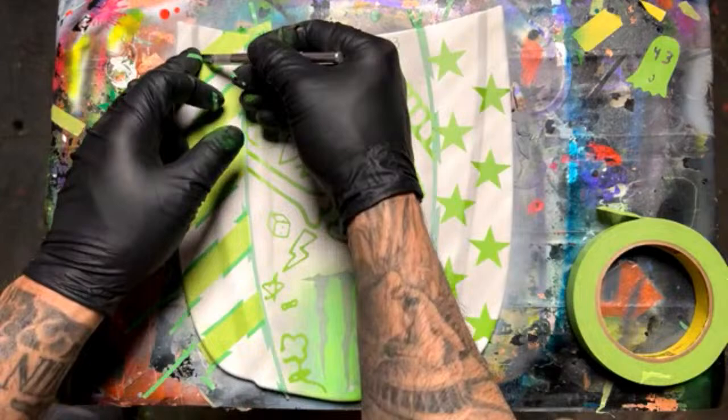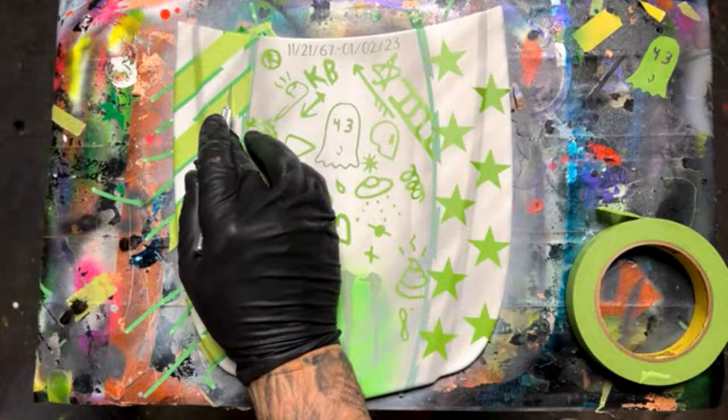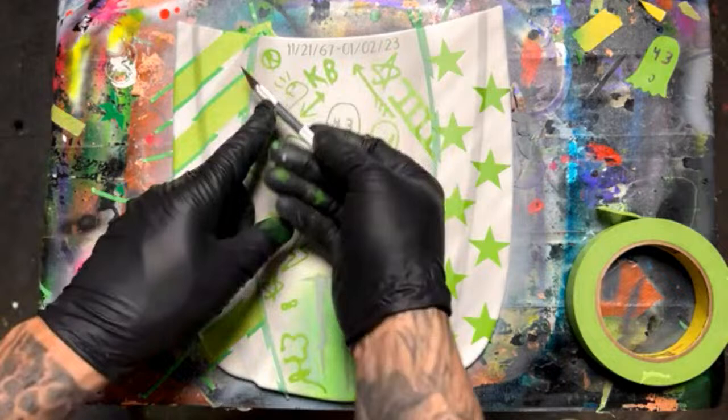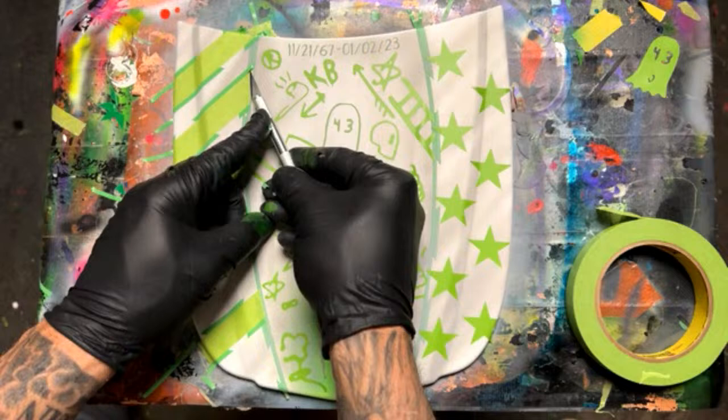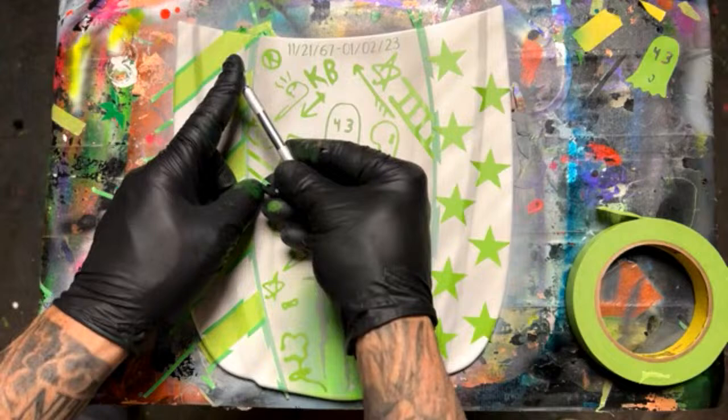Do you recommend a certain color for the base, they say. Yeah, well, on candies, definitely a silver base, or you can use any kind of a light pearl base. Definitely not black in that case, but for the base coat pigments, you can use whatever base you're using. So it kind of depends on, if you want it that color, then you can start with a primer if you wanted to, just a primer gray.